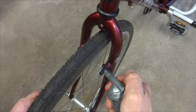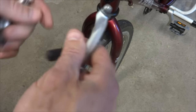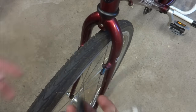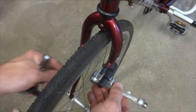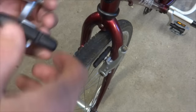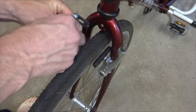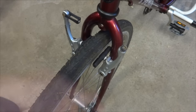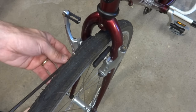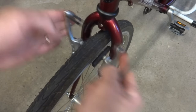Same thing on the front. I'll use a little marine grease on these posts. The brake with the cable clamp goes on the right, and the one with the noodle goes on the left — that's as you're facing the post. I disengage the spring to make it easier to slide on. The little pin goes into the middle hole. Line that up, then re-engage the spring. Same on the other side. Screw in the bolts and when they're tightened, test the brakes — make sure they move nice and smoothly, and they do.